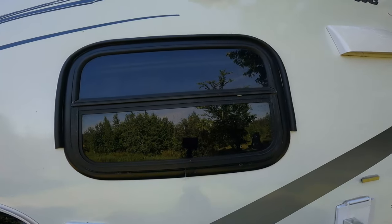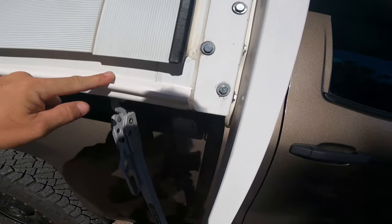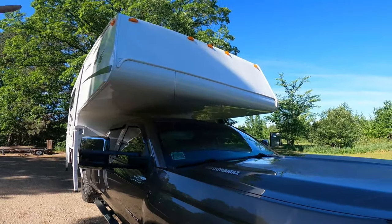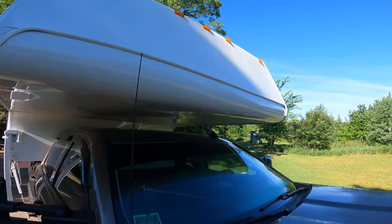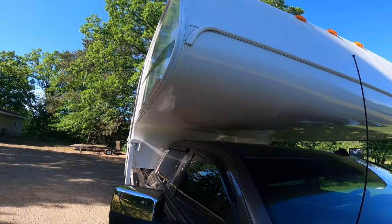My windows have the drip rail going all the way around and it almost just blends right in with the camper. One thing I didn't like was that if it rained at night, a lot of rain would come off the front of the overhang, hit the windshield, and leave streaks the next day. So I put a J-channel to divert all the water away from my windshield. Just remember there's a ton of maintenance that goes into these campers. I like to use Dicor and Sikaflex products — check out the internet to see what works best for you.